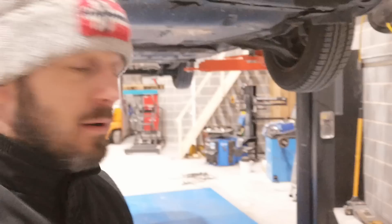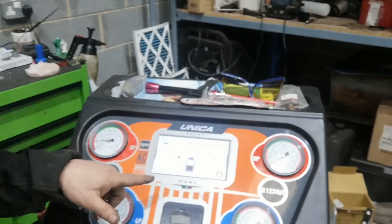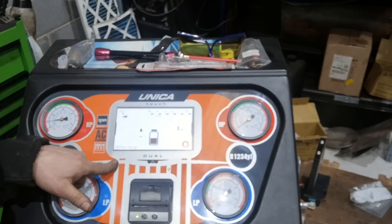The van's back up in the air, under-trays to go back on, and then re-gas the air-con system and that should be it. I'll be taking it home again which I'm quite looking forward to — about 15 minutes and we should be on the road. Van's back on the floor — I'm just gassing the system up there; you can see it putting the oil in. This normally takes about five minutes, takes 450 grams of R-1234yf, plus hybrid oil in the system — not standard oil, just because it's electric.